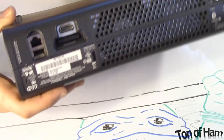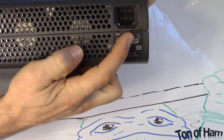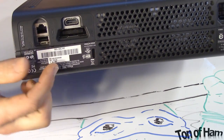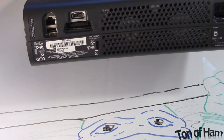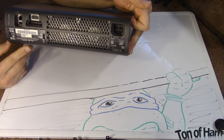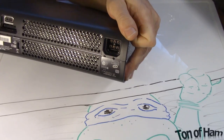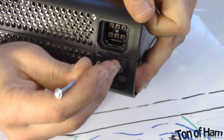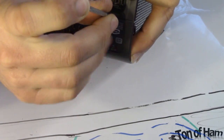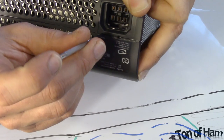This is the infamous plastic clips. They make a special tool that punches in here. If you see these little holes in the plastic — two on this side below where the power plugs in, and five along this side where the internet and video plug in — the easiest way is using two hands: pry with your fingers on the end while you poke a straight-head screwdriver into these slots. Just press straight in, you'll feel a little piece of plastic, and then you'll hear a snap — that one broke free.